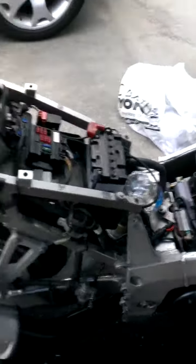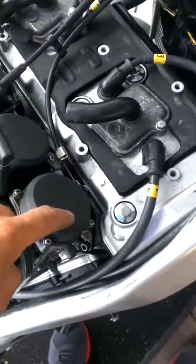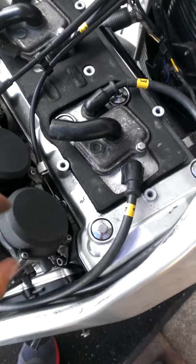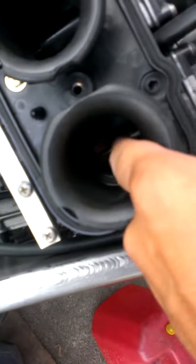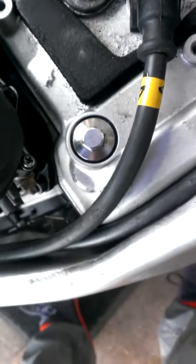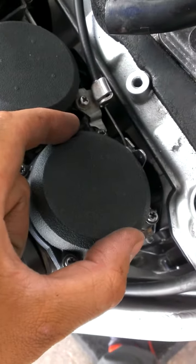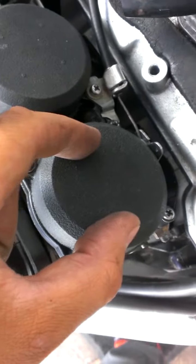3rd attempt and running back. This time I had to fix the slide inside here — the diaphragm was not sealed correctly inside. So you have to make sure when you put the needle and slide back in, the diaphragm has to sit exactly within the groove of the circle. If it's lopsided to either side, it will not seal correctly.